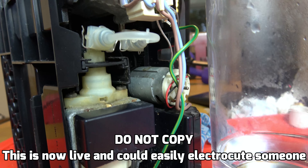Let's have a look at the bottom. You can see a huge amount of scale build-up, and even on the main wires coming in they're absolutely caked. There's lots of scale up here as well, so I'm not exactly sure where the leak is coming from. It looks like there's a load of scale build-up here so perhaps it's leaking from here and working its way down, or maybe there's a little leak up here and a major leak further down the bottom. We're going to plug it in and physically see if we can see water coming out.